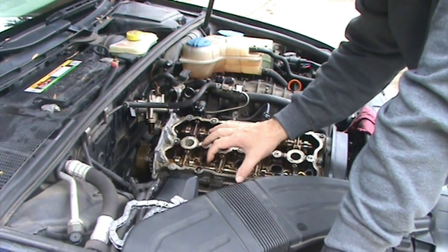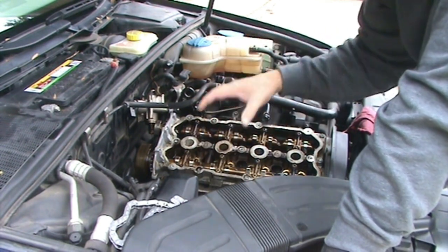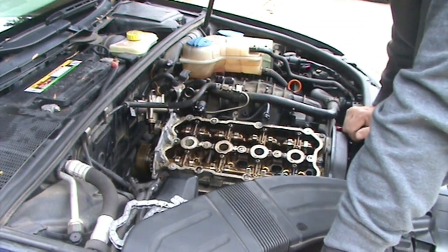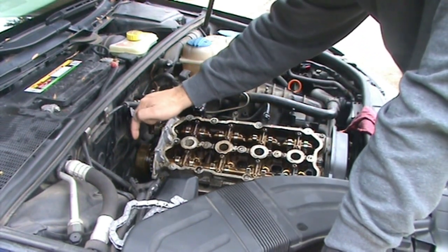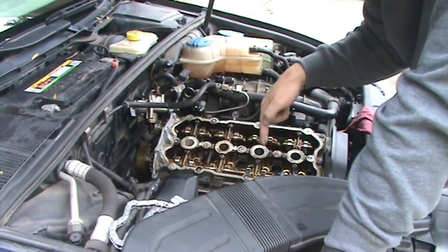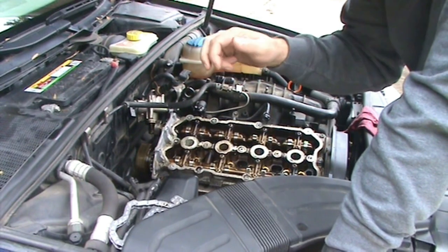And if you're going to do all that, you might as well just go, in my mind, it's a lot easier and safer to pull the cam support, remove the intake cam instead to put the chain on there, rather than spending $140 just to break this and then having to remove this anyway. So that's my thought process behind doing it the incorrect way.